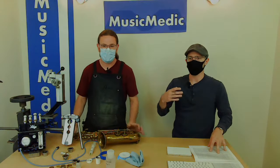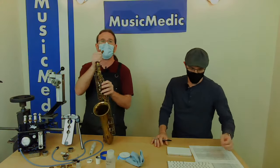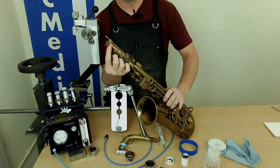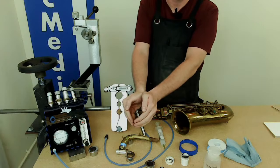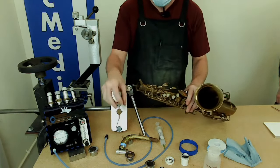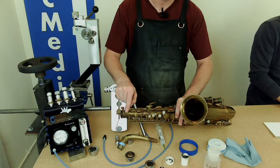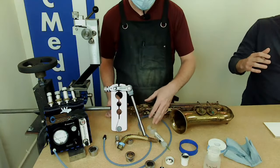As an alternative method, you can use a plug gauge — a highly machined cylindrical piece — inserted into the receiver as tight as possible, and tap down right under that slot. The receiver slot tends to hump up when it's been deformed into an egg shape; tapping it down helps re-round the receiver. That works a lot of times.